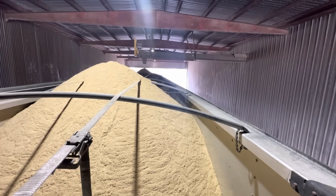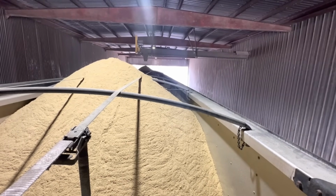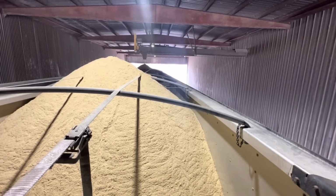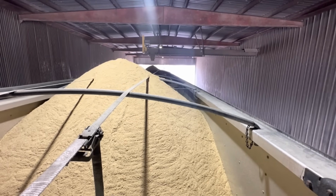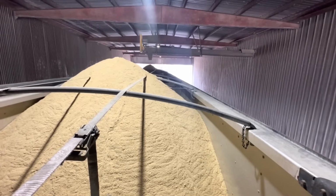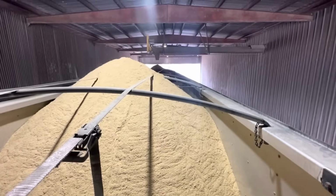I am going to see how this truck responds to having that one vent blown out, which it's responded a heck of a lot better, because just opening the tank up and listening to how much difference the sound is, with how much more return is coming back through there than was, I can see like, yeah, there's a restriction somewhere. We're doing a lot better, I think. So, all right, done with that.